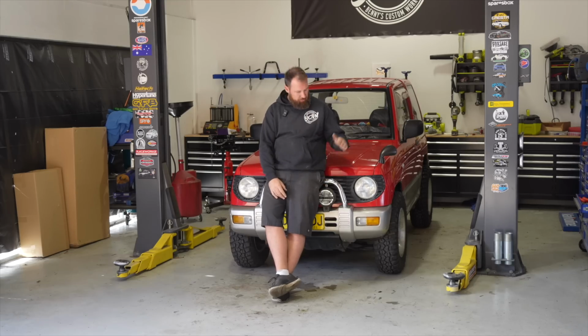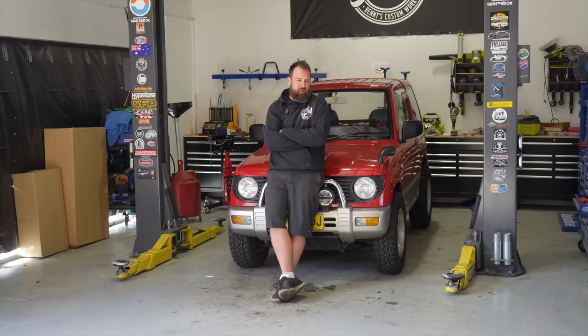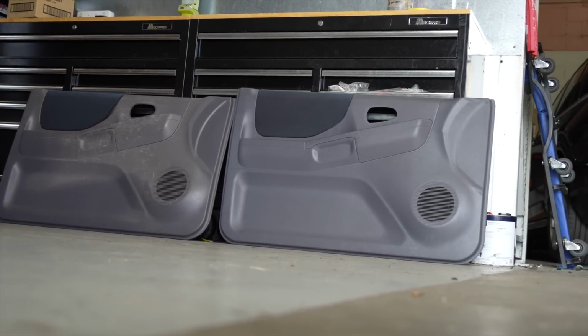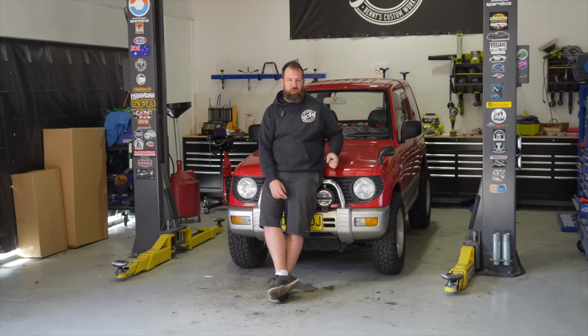And we're done. Another episode on the Paj in the bag. Pretty happy with how this has actually come out. It's been a bit of fun actually sourcing all these parts and putting bits and pieces back together, both from obviously a restoring aspect, for want of a better term, and the modifications of some of the stuff that's going on. Speaking of modifications, you may or may not have noticed, depending on the angle of how we've seen this today, that the lift kit is gone. Unfortunately, at full travel in the front, we're actually getting really bad CV bind, so that is gone.